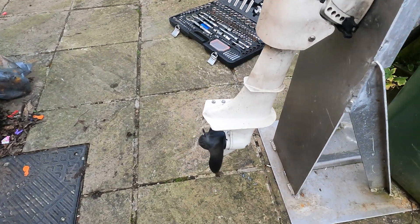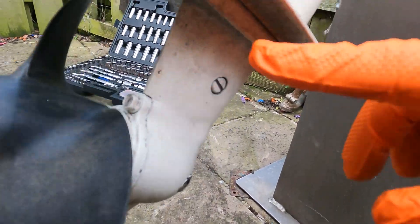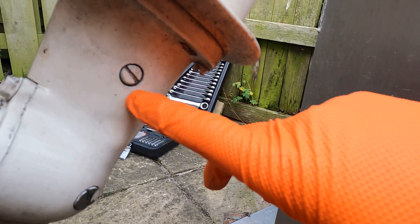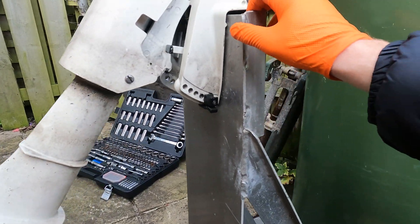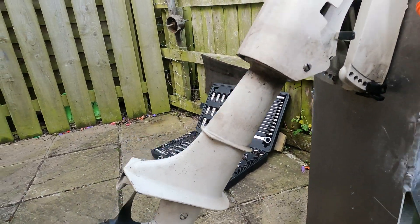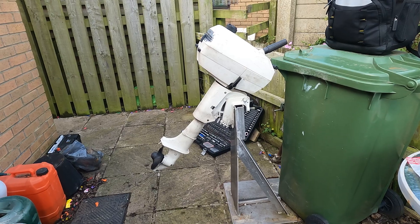What we're looking for is on the bottom here — we've got to lift the engine up. We've got a bolt at the front and at the back. We'll just take those two out and we should be able to lower the lower unit down from the engine. Make sure it's in neutral. It should be as easy as that, just the two bolts.